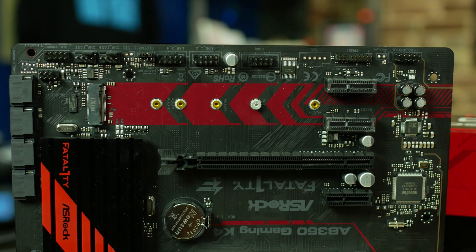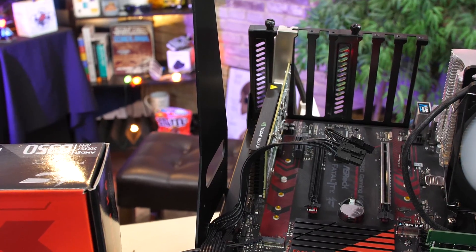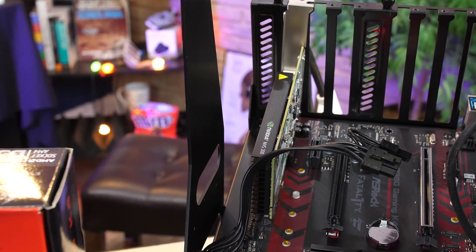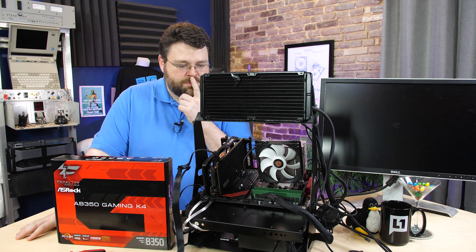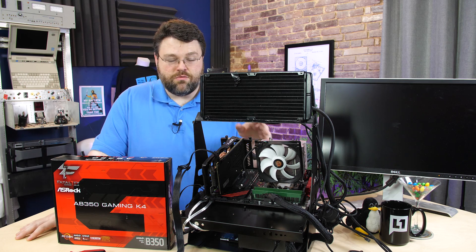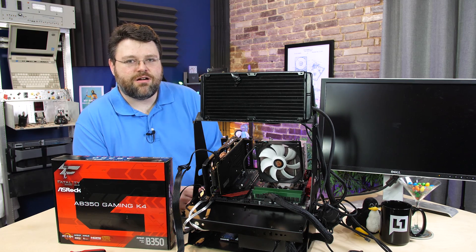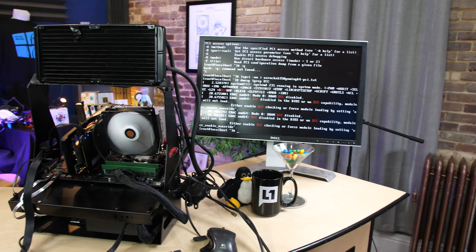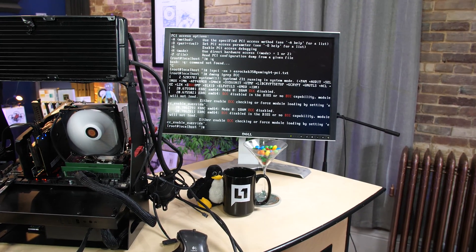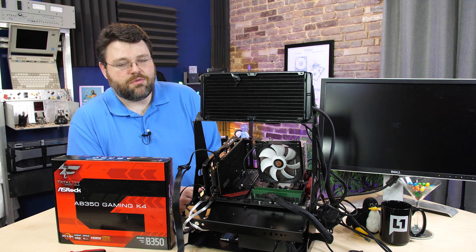On the bottom half of the board, you've got two more PCI Express x1 slots and another M.2 that's PCI Express 2.0 x4 through the B350 chipset. I happened to have this ancient NVIDIA NVS 300 PCI Express x1 graphics adapter, and I thought this would be awesome — a high-speed RAID controller, 10-gig Ethernet, and a PCI Express x1 adapter with a Ryzen 1700 for a super powerful home server running ZFS with tons of hard drives. I was defeated for one reason only: this motherboard doesn't support ECC memory. I installed Kingston DDR4-2400, the same stuff used on our X370 boards, and it did not work on this motherboard. I'm hoping there's going to be a UEFI update to fix that.